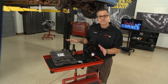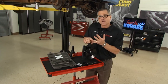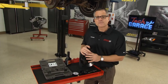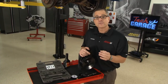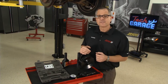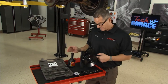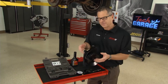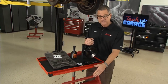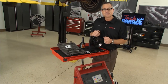Now that you know all these systems well — remember, if the gearbox or rack and pinion fails, there may be some metal or debris. So it's very important that you flush the system and use fresh fluid. Manufacturers recommend about every 50,000 miles. You can do it two ways: you can pull the return line off, run the vehicle, pump it into a bucket — or you can get a professional machine that will flush the whole entire system and make sure that fluid's good and fresh.